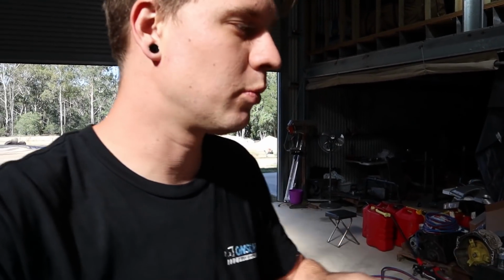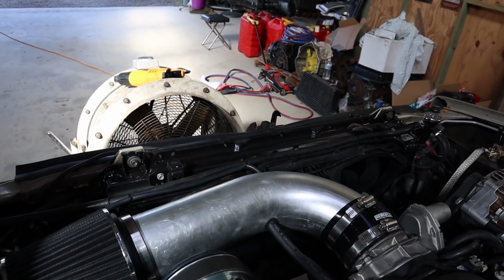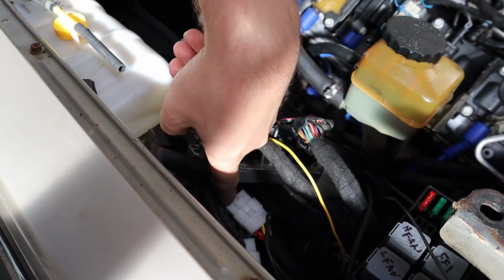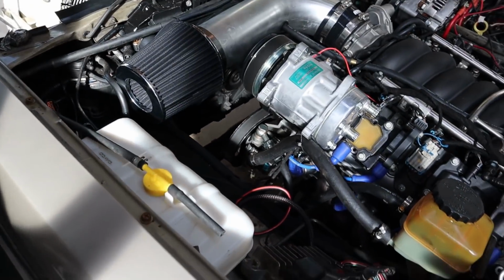Now, I'm not 100% sure what these VE thermo fans actually draw, but things like AU thermos, I know for a fact that they draw like 20 amps continuous and, you know, 25, sometimes 30 amps on startup. So these Narva plugs, they're only rated for 20 amps. So you could imagine twin thermos and then the fuel pump and then everything else. It's massively overloading that single power in the way it is.